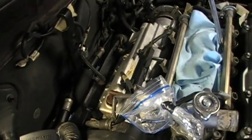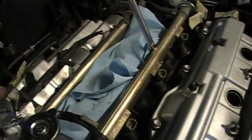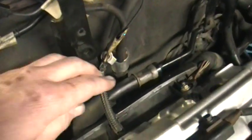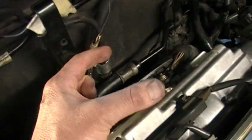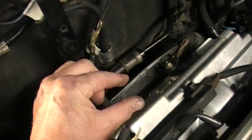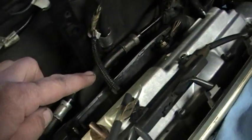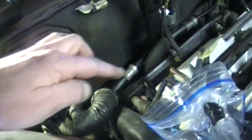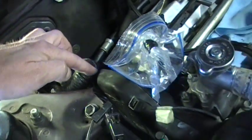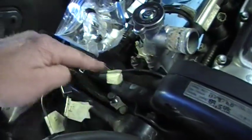There's nothing in the book on how to get this thing apart. The big problem is this area right here — there's a plastic cover that's about that wide, sits like this, and it's about two inches tall. It encompasses the entire wiring harness that goes into a bulkhead here into the firewall, and it also splits off and comes on top of the engine. This rear section is a continuation of that wiring harness — it's all one piece.